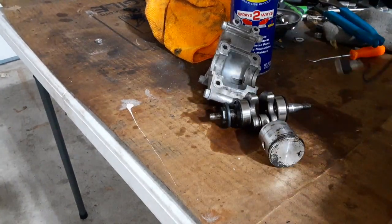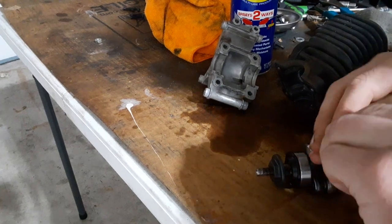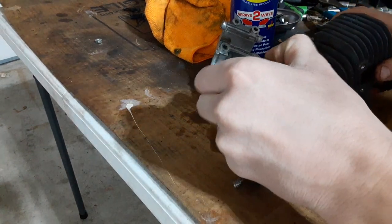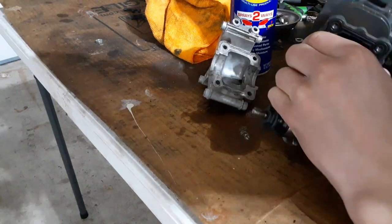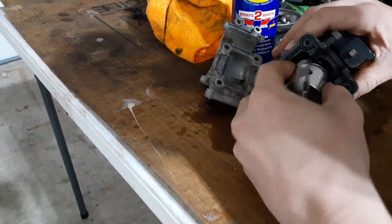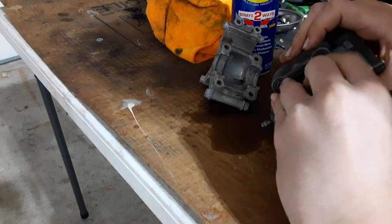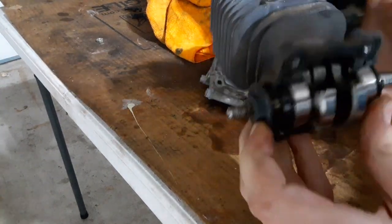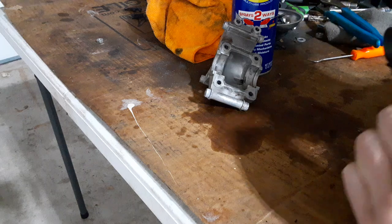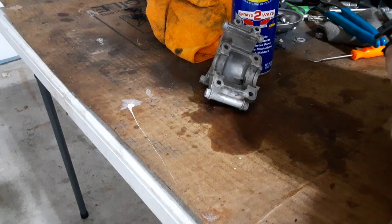If I'm lucky enough there should be a taper in here so I shouldn't have to use any kind of ring compressor tool. My hope is to just push it in and hope for the best. It's going in this way. This is going to be tough — I've got to be able to see this or it's not getting done. There it goes — it's in. It glides pretty nicely too. I'll have to dump a bunch of oil in there. Can I feel any compression? It's going to be a little hard without the full assembly on, but yes — there's more compression.